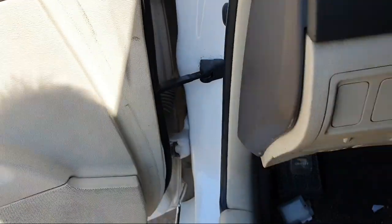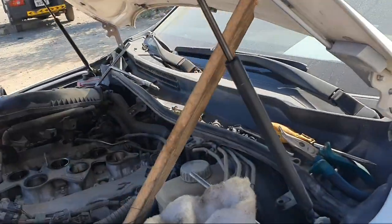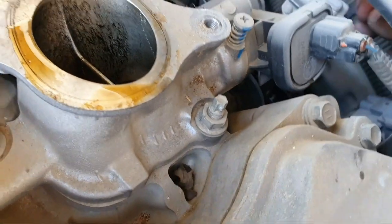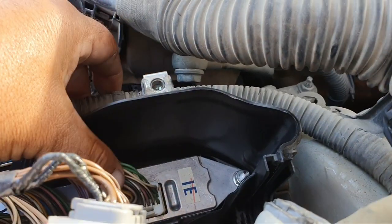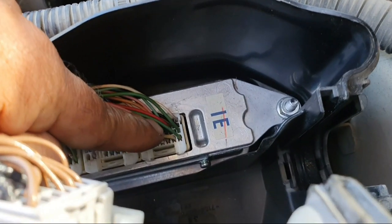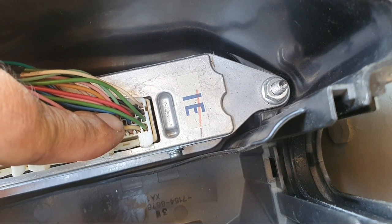When I disconnect the fuel pressure sensor, the engine is running and the check engine light is on. This car's no crank, no start problem is caused by the fuel pressure sensor. The connector pin number seven — the last pin — is the green wire going straight to the fuel pressure sensor. This is the five-volt reference wire. Thank you for watching.